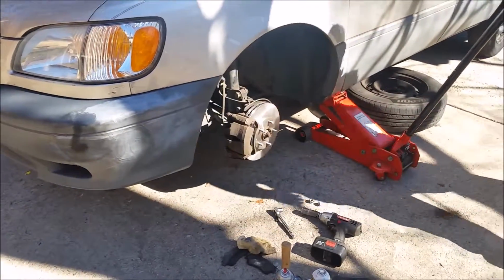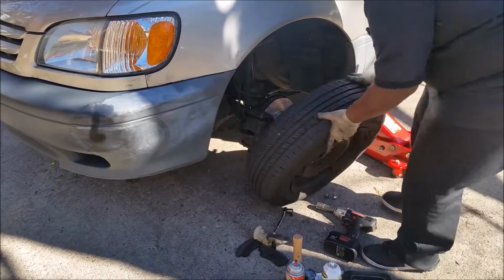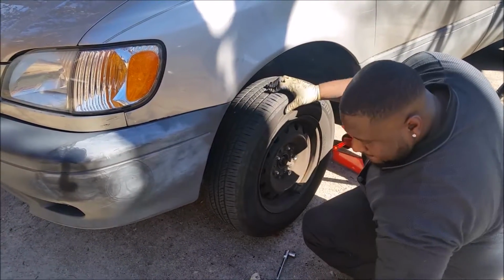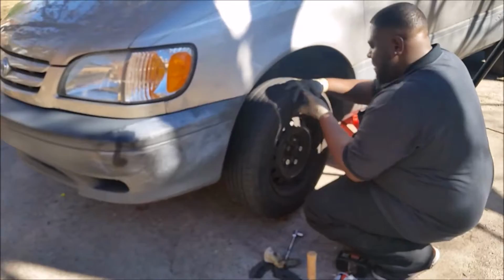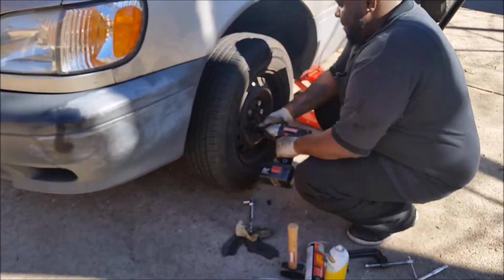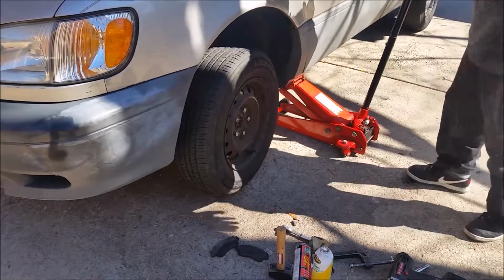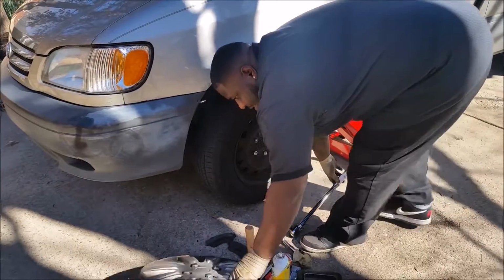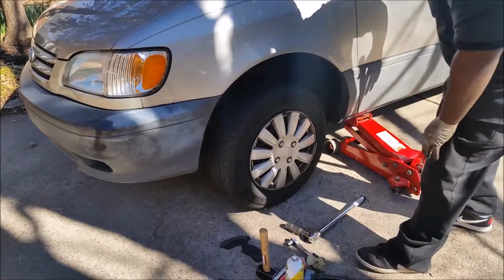Now you're going to put the tire on, and that's it. That's it, done. Just take it down and remove that. I got to put the tire on and put the cover back on. So you close it with an 80-pound bolt, correct? 80 pounds of torque. Okay, very good, with this torque. Okay, good.